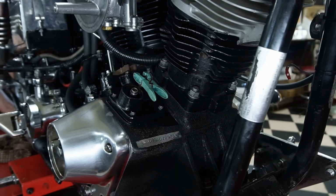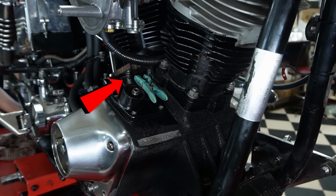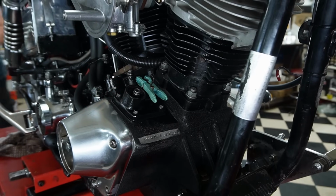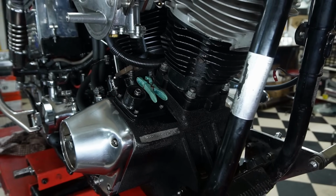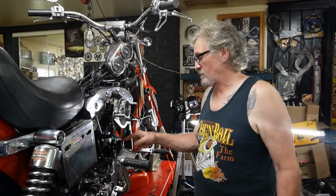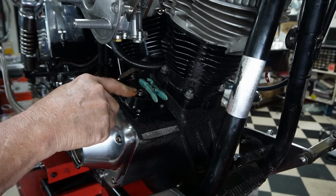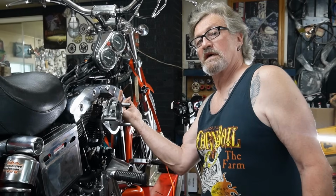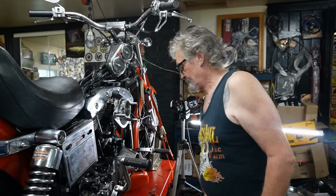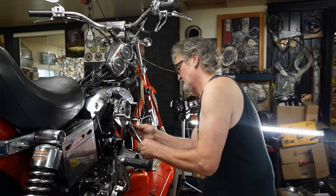There we can see it coming up. Watch for our rear one to come up to the top. That's where we want it there. Always make sure that you have your rubbers in the bottom here. It's an easy thing to miss, and if you put it all together, next thing you know, you'll have oil everywhere. Also, up inside your head, make sure that your rubbers are seated up inside there. And make sure your rubbers are in here, of course.